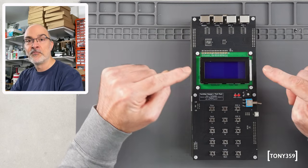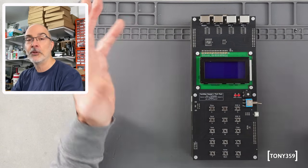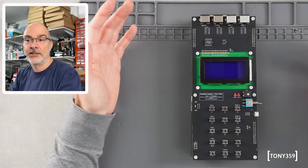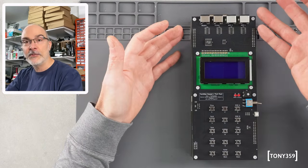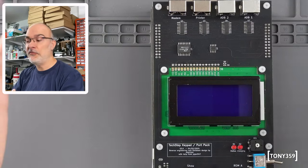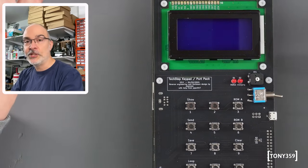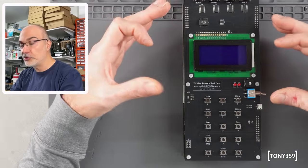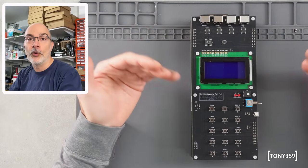So when the computer starts, the TechStep will put the computer into a specific special diagnostic mode and from the TechStep you can run diagnostic tests — like logic tests, RAM tests, sound tests, ADB port tests and everything — even if you don't have a video output. The idea is that if you have a computer which is completely dead, or like my Color Classic which is only playing the death chime, you might be able to plug this in and trigger the computer into this diagnostic state and get some kind of feedback on what's wrong with it.